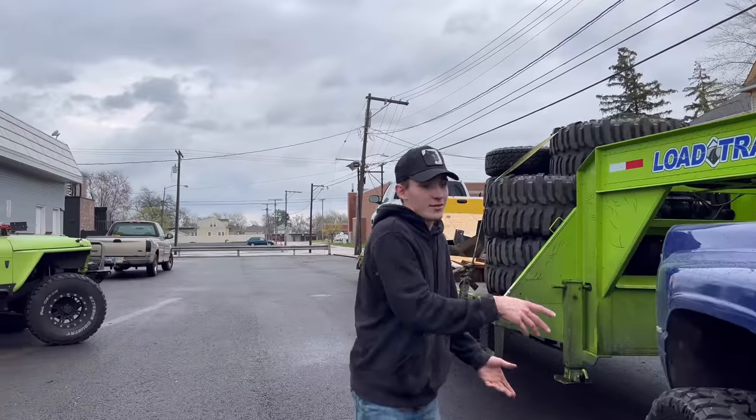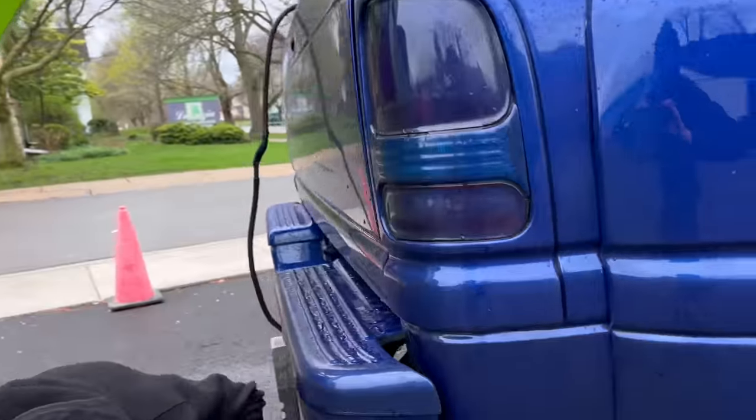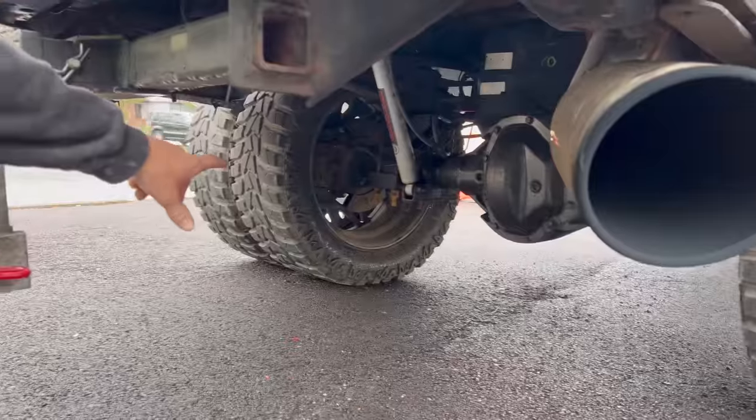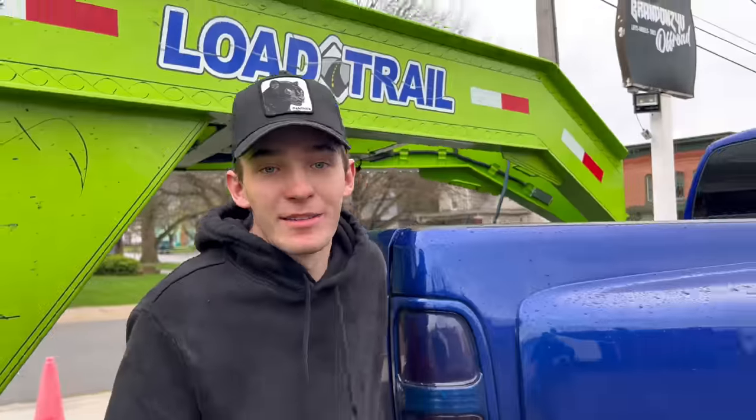I'm going to paint the axle brackets but I haven't gotten to the rear yet. All I did was lower the rear down, so I swept the block out. You can see the axle brackets on the axle — don't mind it, still got it cleaned up. All we care about is that it's rust free. I also went ahead and built a trans cross member for it, and I built a cross brace that bolts in between the cradles to brace them from flexing.